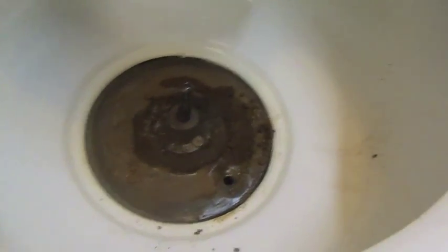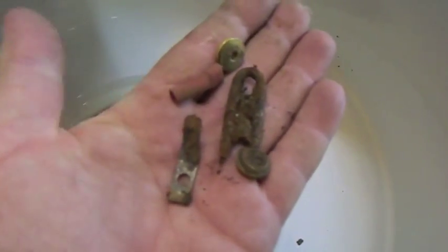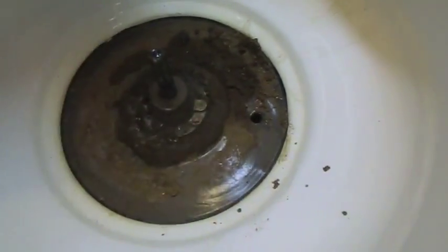I'll just take that agitator out, and it was absolutely... I've already started cleaning that. The chockers were silt. You couldn't actually see the drain hole before. And true to his story, it was full of stuff like this. Overall buttons, bits of steel, electrical terminals. It was actually caked, right up to that lip where the enamel starts, just in crud.